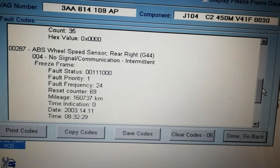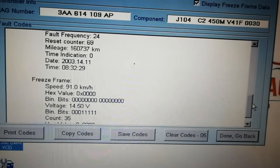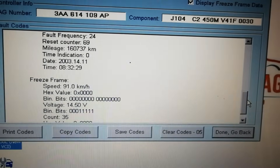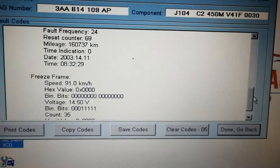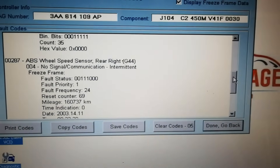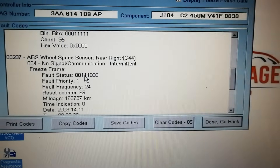That's giving me a direct indication as to what's going on. Next thing I'm going to do is put this vehicle up in the air, whip off the rear right wheel and have a look at the reluctor ring if it's visible, and do an all-around inspection on that area in case there's any damage, wiring, or something simple like that before we condemn the sensor. Afterwards, if everything's okay in that area, I'm going to put the live data on and spin the wheel to see if we're getting any reading from that particular side.